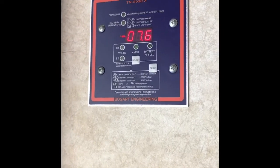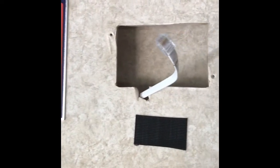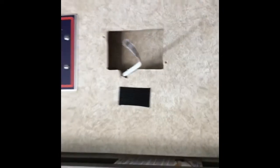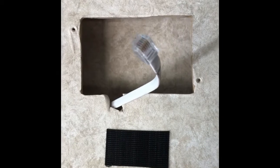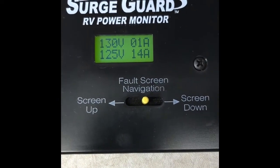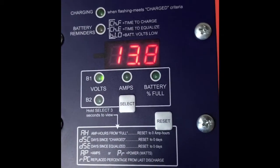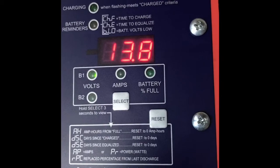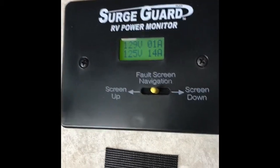What I did for the inside of my RV — what you're looking at right now is the Bogart monitoring battery system, and right beside it I've cut a hole in the control panel of this cabinet. As you can see, it's ready to mount the unit. There's the control wire that comes up from the back of the coach from the TRC, and we're ready to do the install. Here we are on the inside with everything powered up — you can see the voltages as it's monitoring and also the current of each leg, and it's working really well. There's the Bogart monitoring system monitoring my batteries, and since the power is back on, it's charging at 13.8 volts DC. That's the SurgeGuard inside panel — totally recommend this product. Real great stuff.